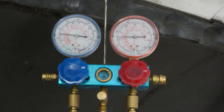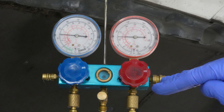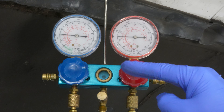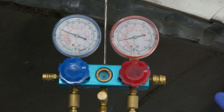You don't need these gauges, but now you understand basically what's going on. The pressure switch is defeated — it turns the compressor on, the pressure drops on the low side, it's not happy with that, so it turns the compressor off. The low side comes back up and then the switch says there's refrigerant in here, so it turns the compressor on again. It's kind of a self-defeating prophecy.